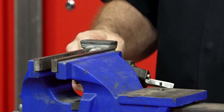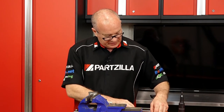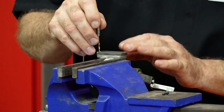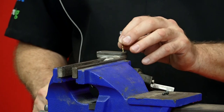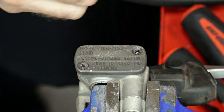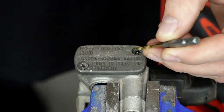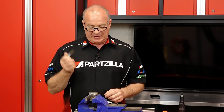Now what would I do if that didn't work? Well, your last option would be to drill it out, but there is a specific way you need to do that. You want to pick a small pilot drill inside of the diameter of the actual threads because we don't want to damage the threads. Basically all we're wanting to do is just drill down a little bit, maybe a quarter of an inch. Then you come back with a larger drill bit with the same angle as the seat, because all we're trying to do is remove the material in the outer area so you can lift the cap off. Drill with the small one first, then finish off with the larger one, and hopefully you can grab it from the side with a pair of pliers and extract it. Now if it's really corroded in there, it's pretty much going to be game over — you'll have to drill it all the way through and it's going to take a fine touch to re-thread it. At that point you're probably going to end up replacing it, but I'd still give it a shot.